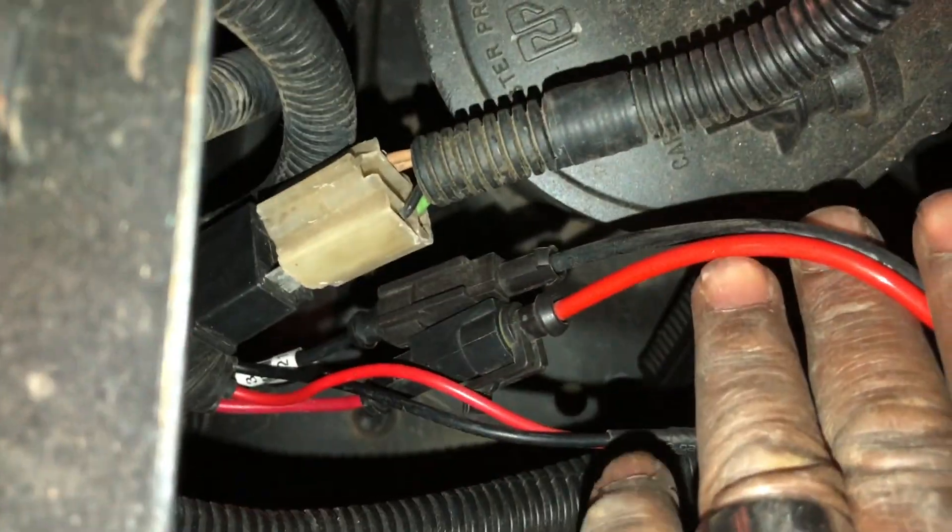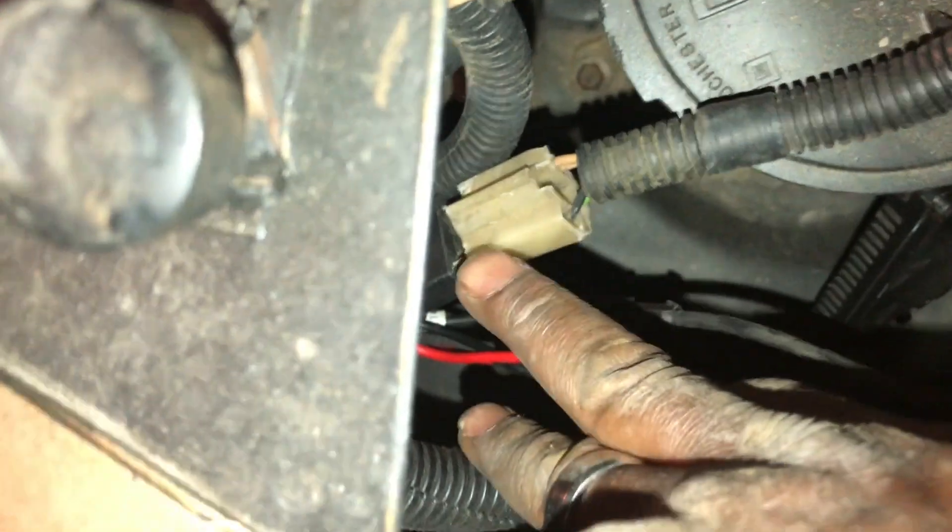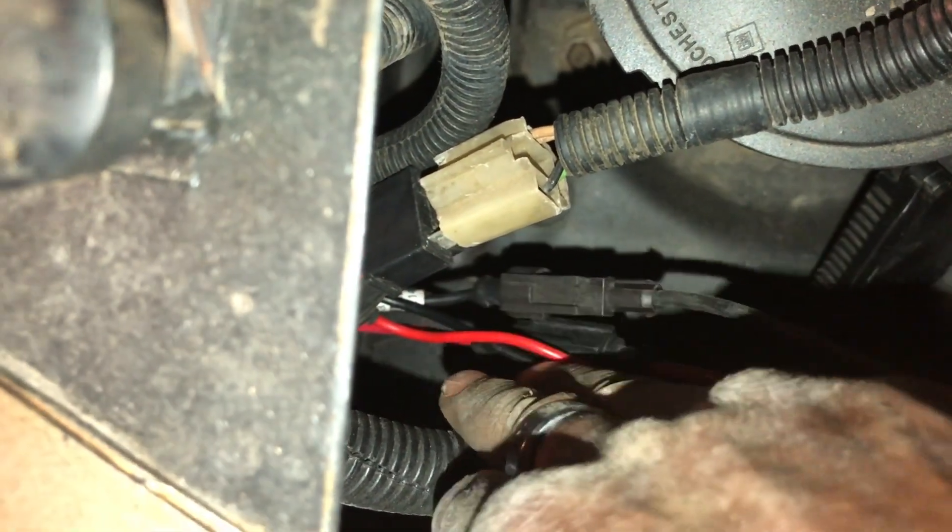From the light, you're gonna have to manually wire this because it's a regular harness. You've got power, ground, then power and ground for the low beams, and power for the high beams — so when you put the high beams on, these turn on too. I had these in a Crown Vic back like 2013. It's the same way — power and ground, red and black on these two. On some it's just plug and play, but these have three wires so you gotta wire that manually: power and ground for your lows, then plug and play for the rest. If you've got like an '87 and up G body, B body, or A body, those come with the 906s and those are all plug and play.